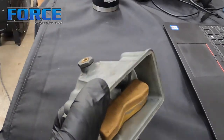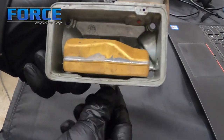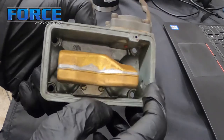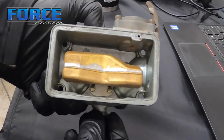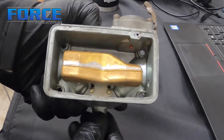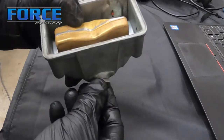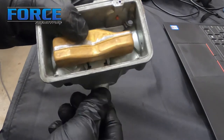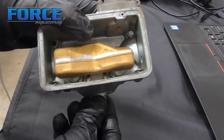With the needle and seat in here, see — it's all the way to the top still. I'm going to continue to screw it in. You can see the sight plug hole right here. That's about where I would usually start it if I'm doing a carb rebuild — right around there, top of the float, about halfway up the sight hole on the side. When you're in the car and you're adjusting this, you loosen it to raise the float level. You tighten the 5/8 hex nut to lower the float level — gives you an idea of what I'm doing when adjusting.